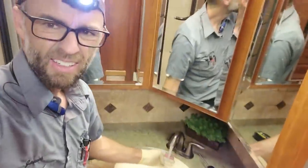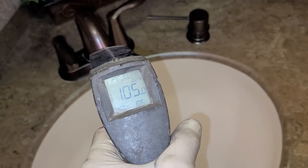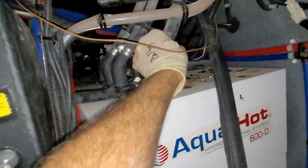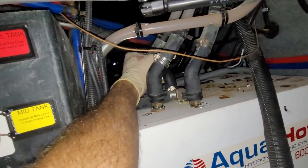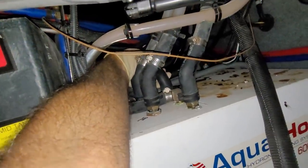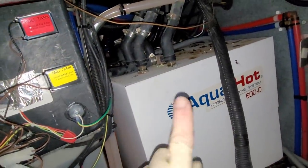I can even turn the water right here — that's getting warm enough, 105, 108. So the AquaHot is on on diesel, and the thermostat's calling for it, so the diesel burner's on. If you go outside, you'll probably hear the AquaHot running. Pay no attention to the water leaks — that's my fault from doing something else. If I grab these hoses right here, I can feel this one's hot, that one's not hot, this one's not hot. That one's even labeled master bedroom. A lot of times on this manifold there's a check valve, and sometimes it'll get stuck. So let's see if we can't free it up.